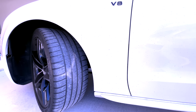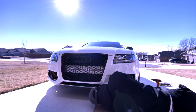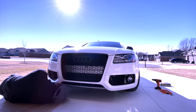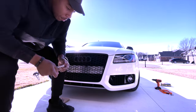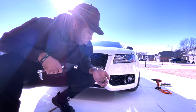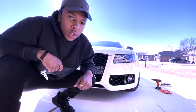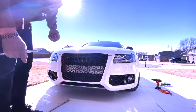Finally got those bolts up there, so on to the next step. Now we're going to get the bolts up underneath the bumper. We got out all of those Torx 20 bolts, so we'll go ahead and pop the hood — there are a few more things to unscrew up there. Then we'll turn it back the other way and take off these other two side bolts holding on the right side of the car.